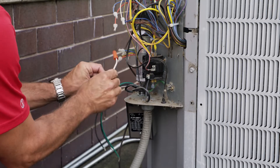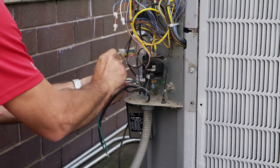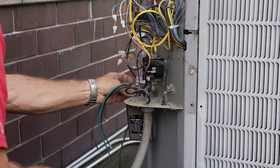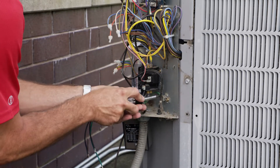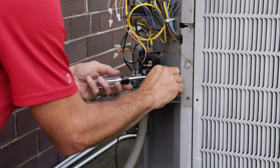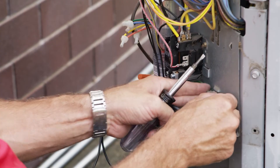Just roll the white wire up inside there. I like to tie a knot and secure it with a zip tie so it's out of the way and doesn't bother anything. First thing I like to do is take the ground wire and tie that to your ground lug — that's your chassis ground. Make sure your ground is still seated in there after you push it in.